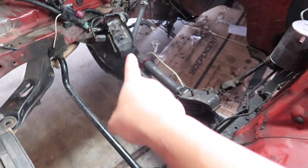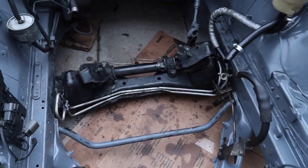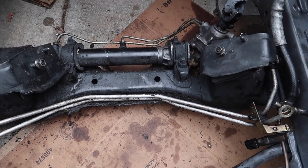I'm gonna take the motor mounts from the S14, but at the same time I'm gonna take the poly steering rack bushings too, because since it's out already, we might as well swap them now. This one is going bad, you could tell. Might as well replace that as well.